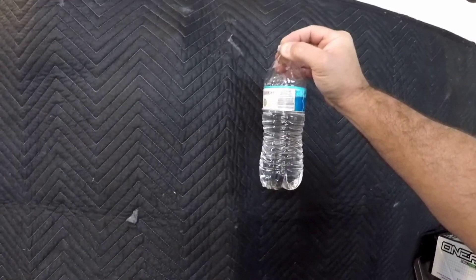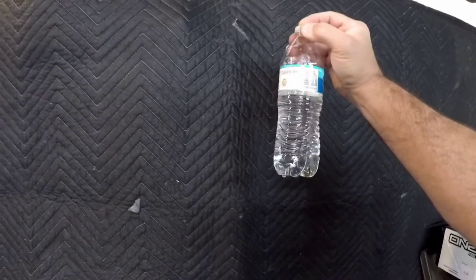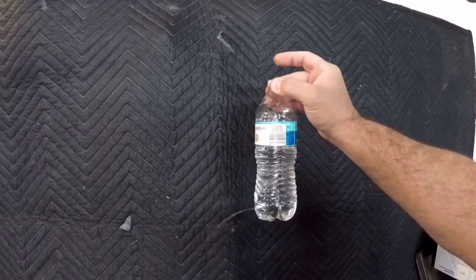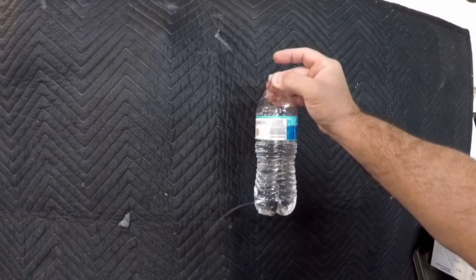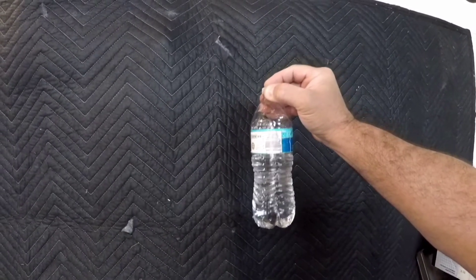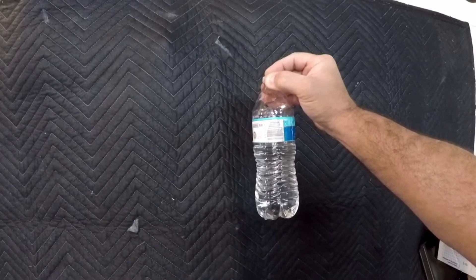You see what happens — basic science. Your engine is going to start chugging, it's going to start dying. It'll run rough, it might turn on and off. This is why you have a vented gas tank with a vented cap. A cap with no vent — for example if you go aftermarket or use a fancy racing cap — is why they include the vent.